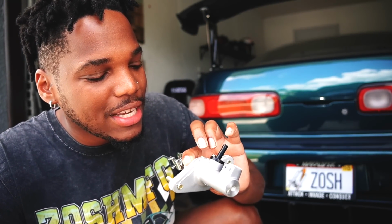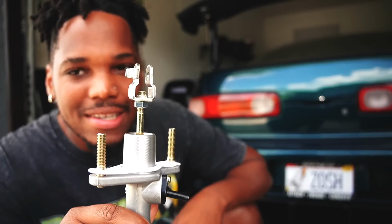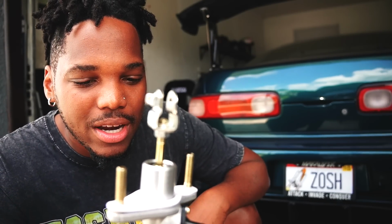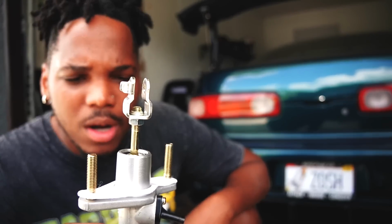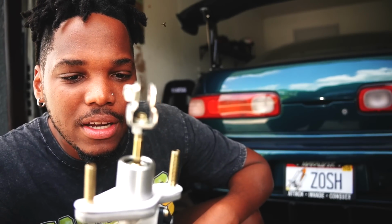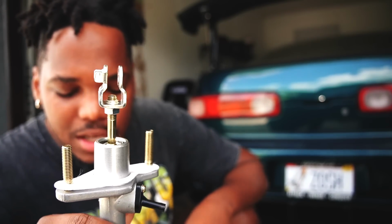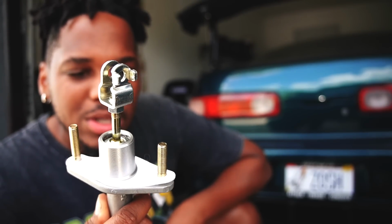Like I mentioned, the first order of business for today is getting this brand new CMC in. This master cylinder is going to delete the actual CDV, since it's mounted onto the actual clutch master cylinder, unlike the GD3. So this would be the first install on YouTube of a GE8 Honda Fit having the CDV delete valve using Seb's Garage kit, which is this line. He also provides you with a brand new CMC for, I think, $150 shipped.